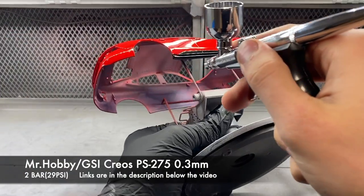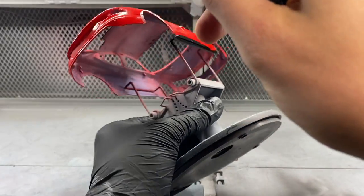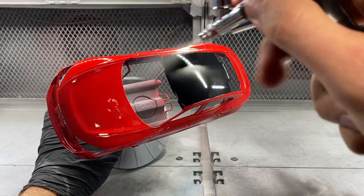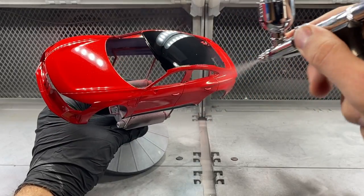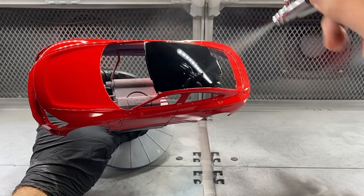With the first coat of clear applied and 5 minutes of cure time passed, I did notice that it went on a little bit too thick and the clear coat needed to be thinned out a little more. It is getting a bit colder where I live, so adding a bit of thinner to your clear coat helps. This splash paint normally doesn't need a thinner if it's a warmer climate. You just add the two parts together and you're good to go.